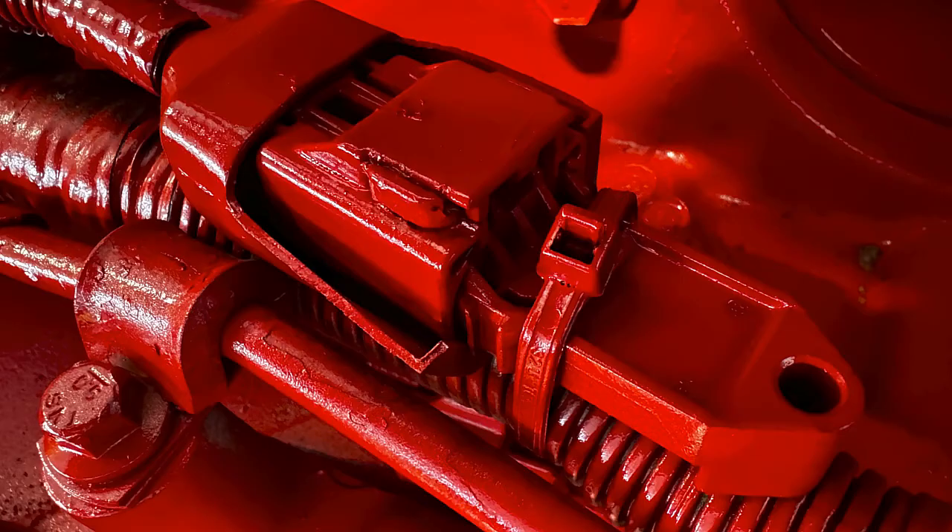On this engine it's just tied to the harness. In the next slide we get a close-up where you can see the mounting hole. It has a sliding lock and then a push tab to get the sensor out of the harness. It's a very small, very light sensor with a pin hole on the other side — that's where it measures the ambient air pressure — so if you paint the engine you don't paint the hole shut. It's a three-wire sensor: a 5-volt supply, a ground, and a signal to the ECM.